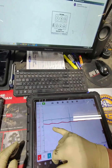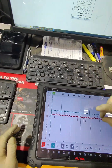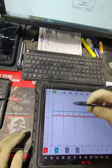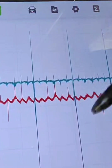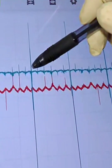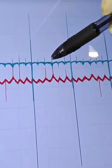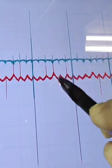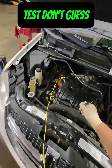I'm going to go ahead and zoom in so you can see. Right here — this is our high hump right there. The firing order for this vehicle: this is where our coil is firing, so every six — one, two, three, four, five, six, and then one. So this is cylinder one, two, three, four. Now we know that number four is the problem right there. I had a code for cylinder two and cylinder three, but number four shows a high hump every single time.